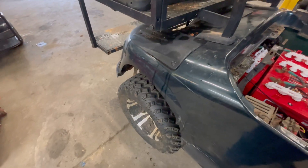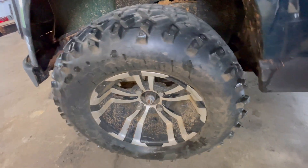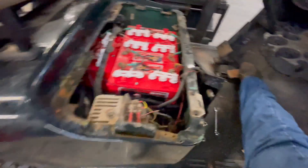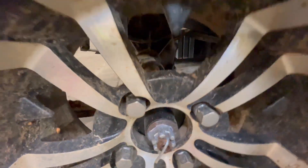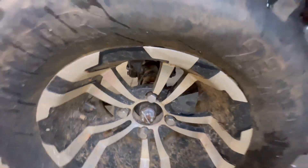Pretty much the same thing off the ground — it still barely moves. You can see it's floored and it's just barely creeping. You can hear the motor just kind of working against itself. That's typically a sign that the encoder bearing is out.